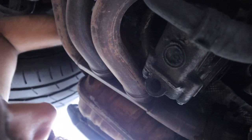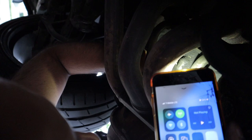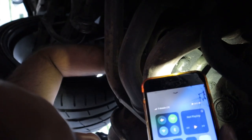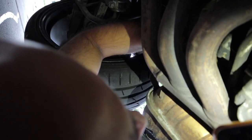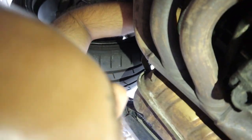I'm gonna show you. One, two, three. You feel it with your hand? Where's your third one? At the bottom — it's like a triangle. Okay. The easiest ones are the two top ones to take off, you can use the ratchet for that. The bottom one — try the extension, a shorty, a deep socket, and the ratchet.